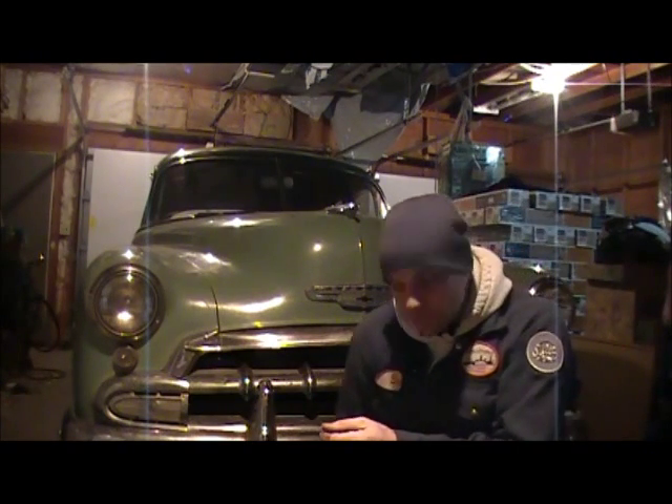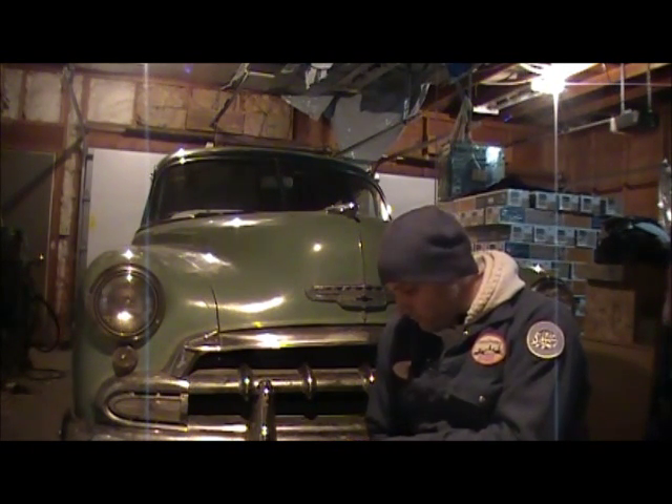I'll take this down to the alternator/generator shop tomorrow and have them rebuild it. I'd much prefer to have something like this rebuilt locally by someone who has done lots of them for years, rather than getting some remanufactured unit with unknown quality. So anyway, we learned how to test the generator a couple of quick easy ways — one without instruments at all just to see if it spins, and then to see if it's putting out enough voltage. We also checked the wiring between the generator and the voltage regulator, which appears to be good since new wiring didn't change anything. We'll get this rebuilt and get back on the road. Thanks for watching another one of Eric's projects. We've also got some GMC Jimmy work coming up — building a front drive shaft and a cut-and-turn on the Dana 60 front axle, done a little differently. Thanks for watching and God bless.